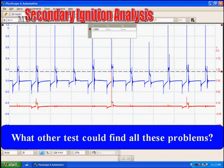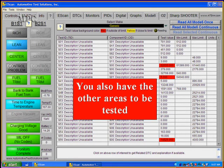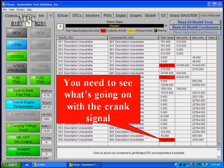That's why we're so high on this type of diagnosis. Don't forget we also have an EGR problem and an EVAP problem. We shifted it to the customer: do you want to have your EVAP and EGR repaired at this time, or wait until they turn the check engine light on? The answer was, I just want the misfire to go away. We told them when the check engine light comes back on, bring it back. The check engine light did come back on a few months later for a P0125 — a bad thermostat — and she brought it back. You also need to see what's going on with the crank signal, since the misfire monitor couldn't detect misfires because of a TID 56 problem.